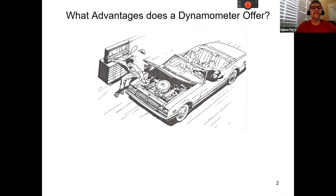It's very important that we get the most out of this training — learning the ins and outs of the dynamometer, how to use it, how to calibrate it, and how to use it safely. Many people shy away from the dynamometer because it seems like a huge machine that could cause damage or an accident if used incorrectly. But it's actually a very safe device. Most shops don't even strap the vehicle down because these are called inertia dynamometers — specifically inertia eddy-current chassis dynamometers — which are not like a typical horsepower dynamometer.